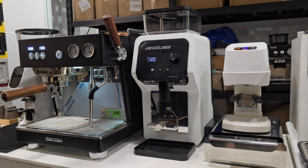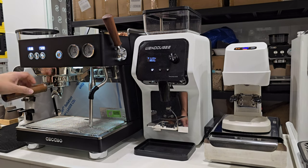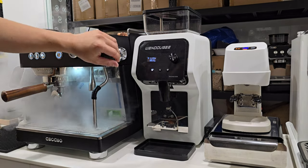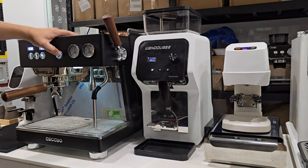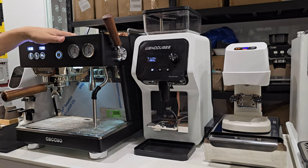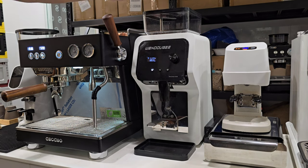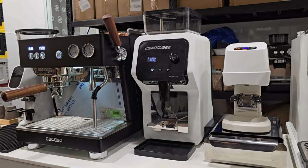What's so special about these three pieces of equipment? This is the Ascaso Baby T Plus — it is as good as the La Marzocco Linea Mini in terms of build quality and power. It's a dual boiler rotary pump machine with volumetrics, a saturated group head, a very powerful steam wand on a lever system, hot water, and it can run on a tank or plumbed in and out.